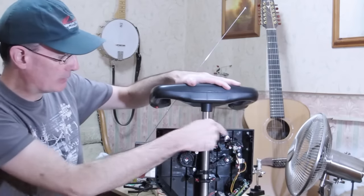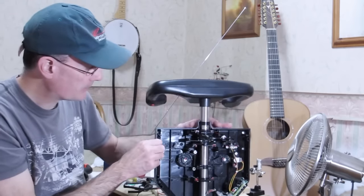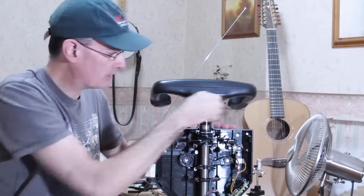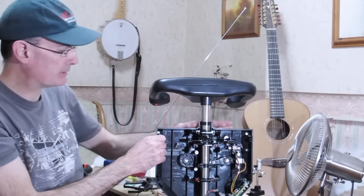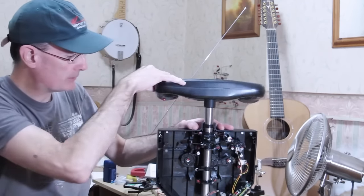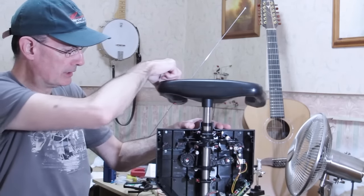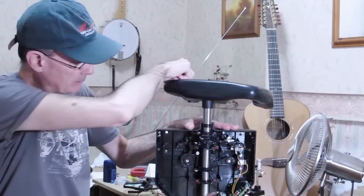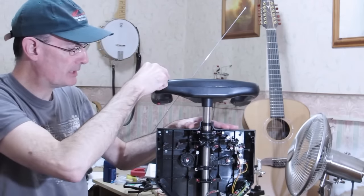You can see this fairly complicated set of cantilevers and little devices that basically operate a potentiometer right down here for the aileron axis, and that is resisted by the tension of this spring here, which works in a sort of dual action. You know, the engineer in me is kind of fascinated by that. It gives a detente in the middle, which isn't too intrusive.